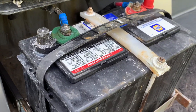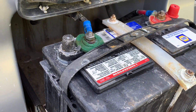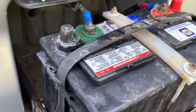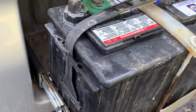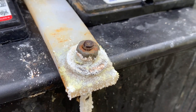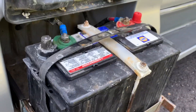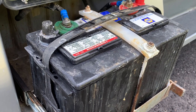If you're going to the auto parts store anyway, make sure you get some dielectric grease, because when you go to put your terminals back on you're going to want to coat them — that will help prevent rust. And it looks like I should spray this one with some PB Blaster and let it sit for a bit, so make sure you calculate that into your time to finish this job.